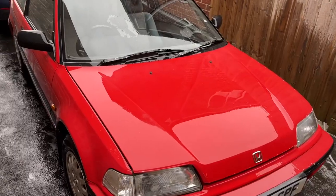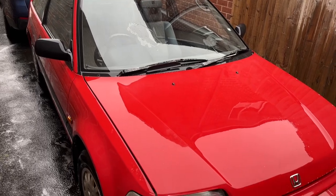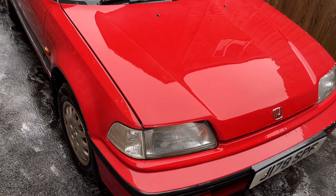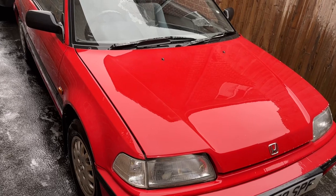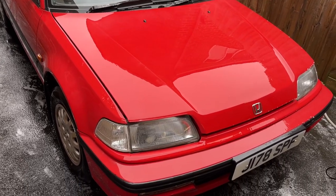There's a few little bits here but yeah, not bad. So the whole car is decontaminated now — degreased, iron fallout treated, double snow foamed, and completely jet washed before and after about three times. We've got most of the dirt off the paint. Obviously it's still soaking wet — now I'm going to move on to the contact wash. Clay barring will come later on.